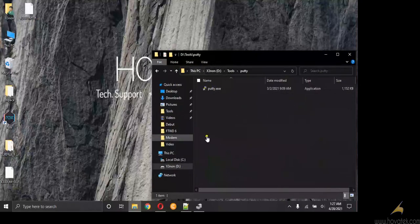I have LG drivers installed. Now I'm going to quickly boot the device into download mode. I hold the volume button — volume up — and connect the device to the PC.